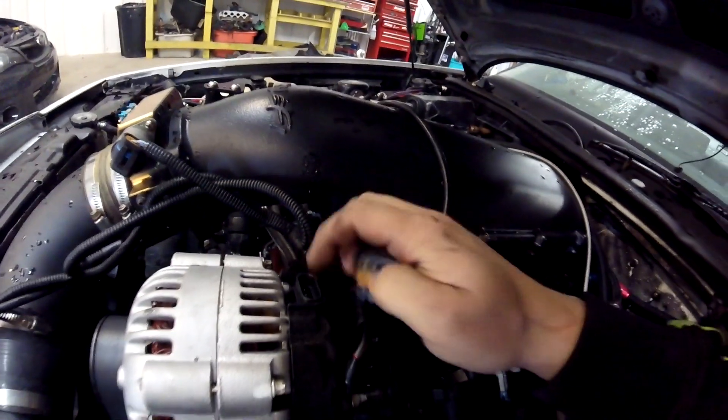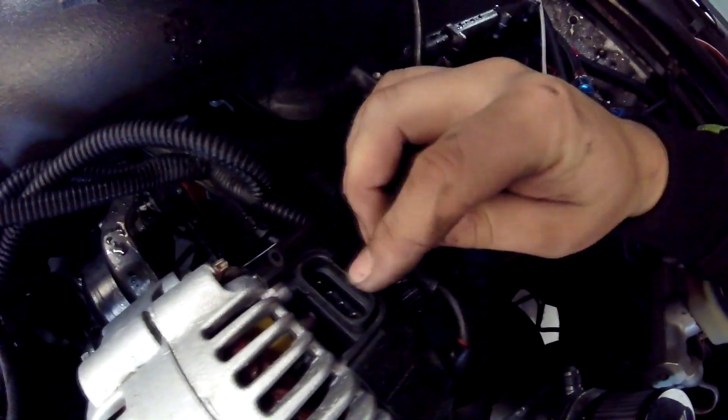We're going to start the car back up and see how it runs. We still have to figure out the alternator — I'm getting one tomorrow. The alternator currently on this thing is off a drive-by-wire car, which has four pins. With MegaSquirt, to keep it simple, you run one wire from the alternator to the battery and a single wire to excite the alternator. This is a four-pin alternator, so that won't work — we need a single-pin alternator for this single-pin plug. With MegaSquirt you also run a resistor in-line with a 12V source, which acts like a dummy light to excite the alternator. Running straight 12 volts will burn it up.